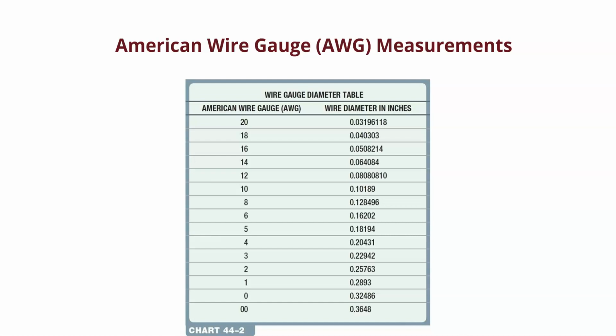And that's why a lot of lighting systems nowadays fail. Why do we go with lighter, smaller gauge wire? Because it weighs less. And if it weighs less, gas mileage is better. So you can see this tug over EPA stuff and durability, right? So when we're talking about American wire gauge, we get numbers like this. Higher number, smaller wire, lower number, bigger.